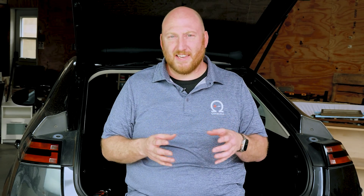We'll show you how to swap the battery — it's very easy. The process involves a big tray in the top and back of the vehicle, which is why we're standing at the back. It's got four 10-millimeter nuts that we will remove, then that tray comes out. There are a couple of Velcro strips that hold the carpet down to the back of the seats; those come off, and then the whole tray can slide out. On the battery itself, it's one of the easiest: a 13-millimeter bolt to remove the tie-down strap, then the battery is loose, and there are just two 10-millimeter lug nuts to loosen. Then the terminals are off — done. Swap the batteries.